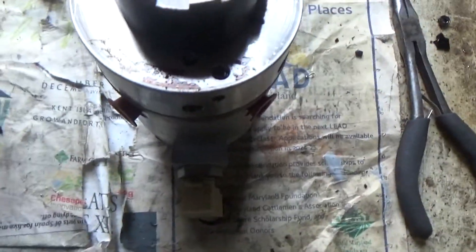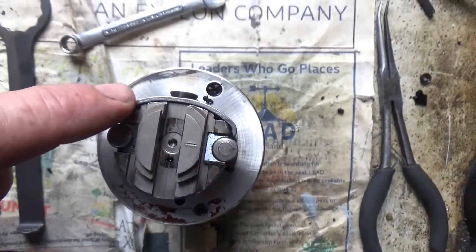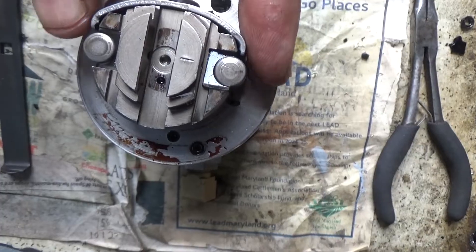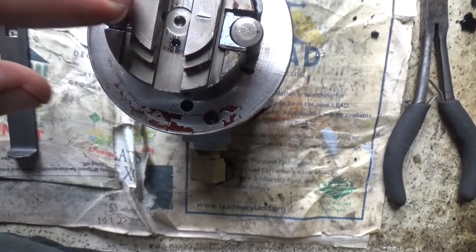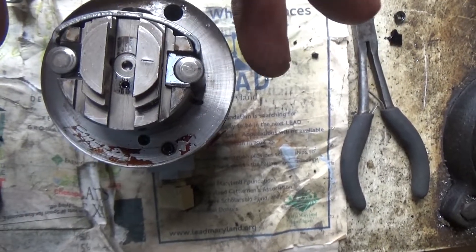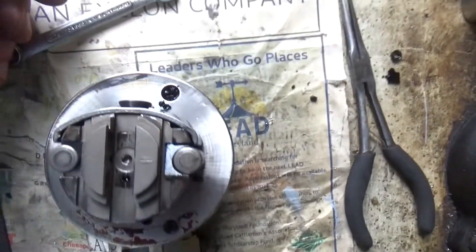But you all already knew all that, I'm sure. I just know some of you are waiting for me to tell you how to turn it up. Just screwing this in further will turn it up but it ain't going to get you much — it will get you some. That puts pressure on this leaf spring thing here and in the center of that, and it opens that up and makes it so that these rollers can come out farther, so there can be more fuel inside there when they do squeeze them together. That's what turns it up, but it won't get you much.